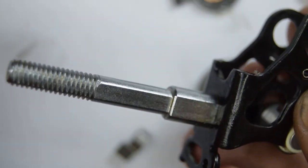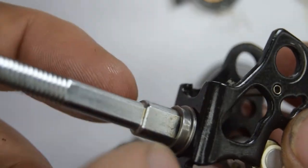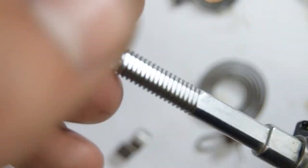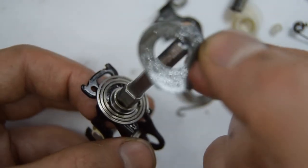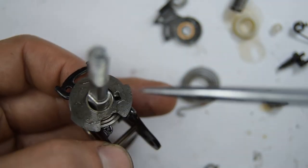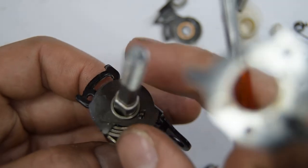I've already had to unbuild this once because I missed one part out. So we're going to put that last bushing that we took out and seat it at the bottom of this bolt. Next there's the spring - that hook part that you can see on the spring is going to latch on here in that corner. Now take this very thin sheet, pop it on the top, and where there's that kind of slit right there, that's where you want the other tip of that spring to go in. I've had to change this three times now.